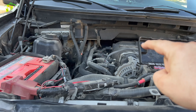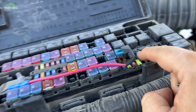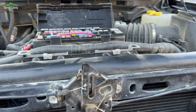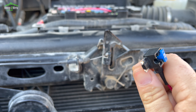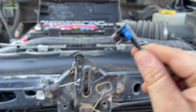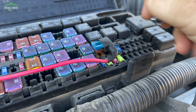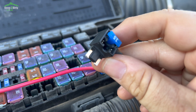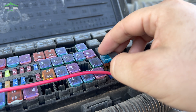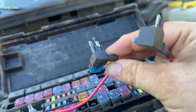Just to make sure this is the line, we stripped it really quick — and yep, as soon as I connect it. This right here is the Y connector they normally use, so you just want to make sure you tap in on one of those connections. Route that to your battery and confirm your relay by using the battery to turn it on and off to make sure your pump is running. Depending on your truck, the relay could be in multiple locations. Ours was way down there — really a pain to find — so we ended up relocating ours to the front for easier access. You can get these relays from any local auto parts store or on Amazon; just match the specs on the relay exactly so you can do a drop fit.